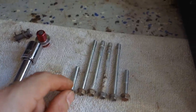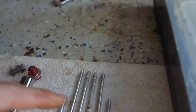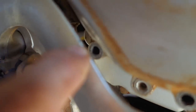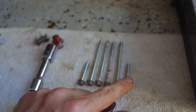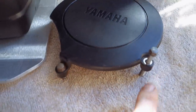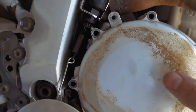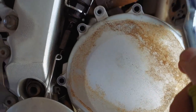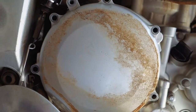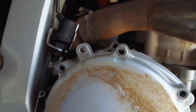There are two short bolts. I typically start with the hardest bolt to get out - that'll be my reference point - and then go clockwise. The bolt that was behind the brake down there is the toughest to get to. There's one long bolt that gets arranged separately. If your clutch cover is hard to get off, it's sometimes going to feel sealed on there - just give it a little circular tap and you'll hear that hollow sound, and it'll pop right off.